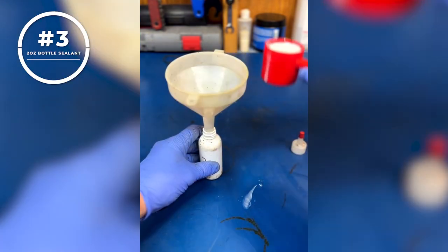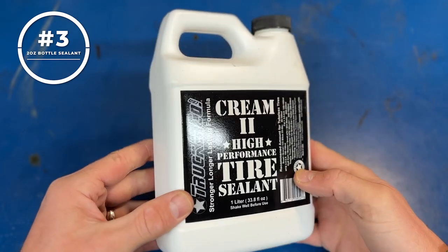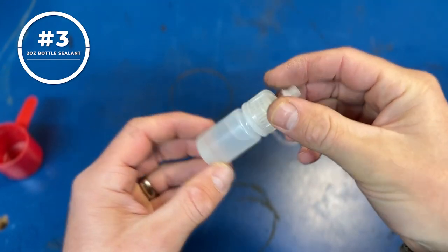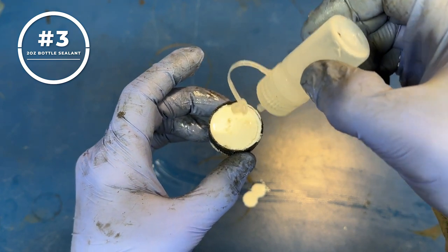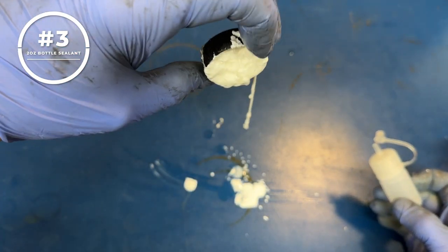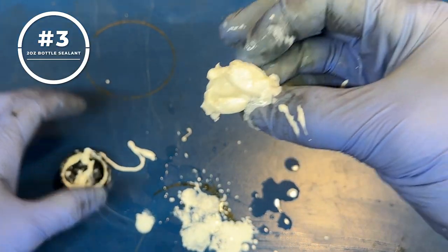You can get a one-liter bottle of Trucker Co for $22 with free shipping — it's 100% made in the USA from American-made materials, bottle and label. Here's a bonus pro tip from the owner himself: you can bring a small bottle of vinegar, or dip your tire plugs in vinegar. The acid makes the sealant coagulate, so you can help a dented leaky rim fill up and seal, or sew up a slice in your tire and use the acid to get it sealed up better. Lemon juice will also work. Chemistry — cool.